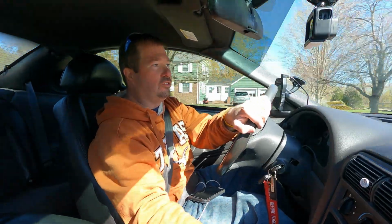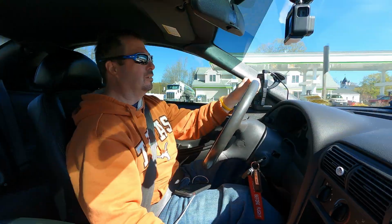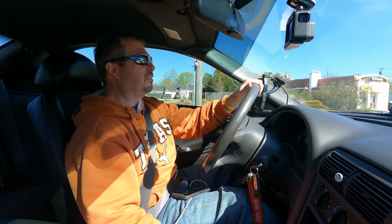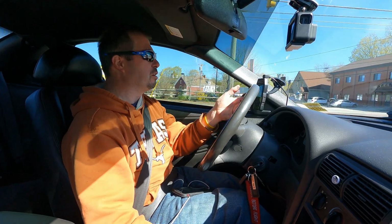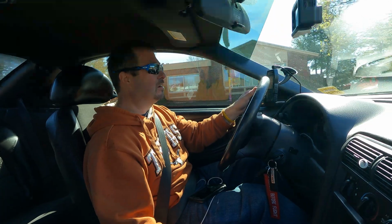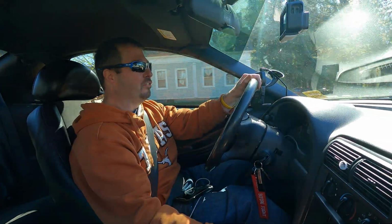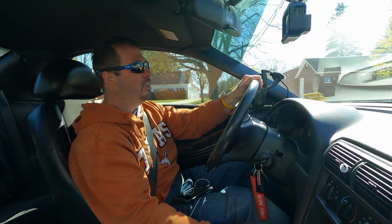I guess I shouldn't have made a joke about not running a belt, because I just shredded mine. Not exactly how I saw this day ending. I thought everything was going pretty well, despite the few issues that I mentioned before. But I went to pull on the interstate, heard this flapping noise, and I'm like, what the hell is that? It kind of sounded like gravel hitting underneath the car. I didn't really think anything of it for a second. And then I looked over at my volts and I was pulling 11.5. And I'm like, oh crap, I think I just lost my damn belt.